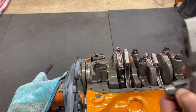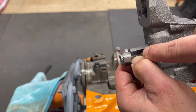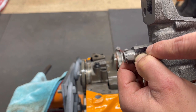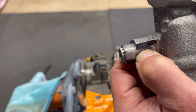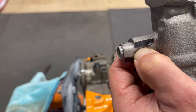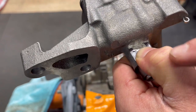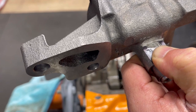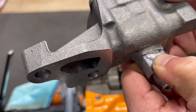So we figured out what we needed to do. What I ended up doing is putting some black ink marker on here and going to seat it to see where it's hitting. If you look real close to where my thumb is, it's worn off that marker — so that's where we need to grind a little bit more to get that to actually seat. I do think right there we're good on height. So John's going to go in and remove a little bit more material and we'll be right back to see if that takes care of it.